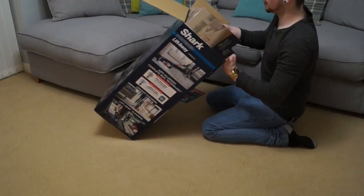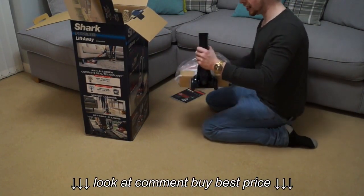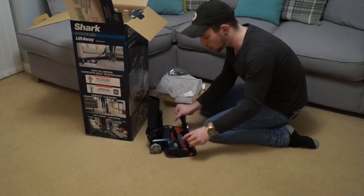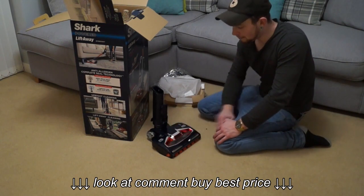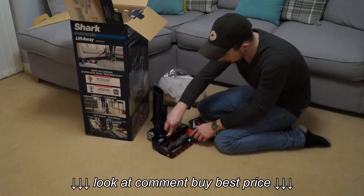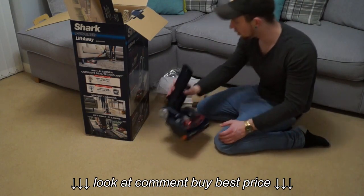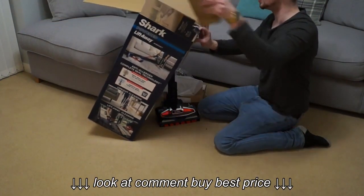Then we come to the brush roll — let's take this out. What is nice to see, as I mentioned before with Shark products, is that they are very sturdy and very well designed. This is on the Shark Rocket machine but if the brush roll gets clogged up with hair, you can press these tabs and take the trim tool out, cut along the hairs, and pop it back. Or you can pull the tab and the brush roll simply comes out. It is an absolutely fantastic system, light years ahead of anything else I've seen. We've got fantastic 8 LED lights on the front and it has the DuoClean system which is brilliant.